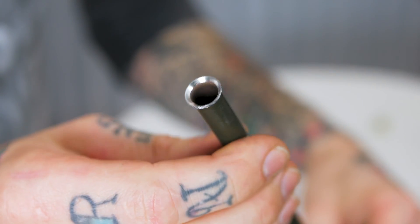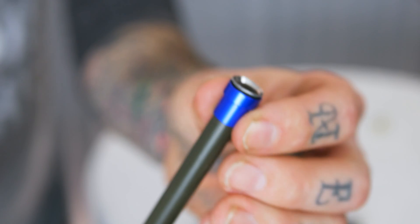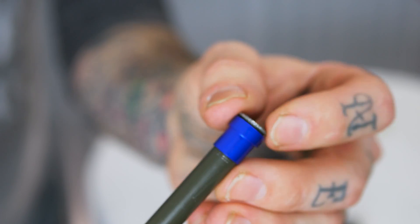That gets you the proper 37-degree flare, and that's it. You can see the 37-degree flare right here — that clean single flare that's going to mate onto that fitting the way it's supposed to, to create a good sealing surface.